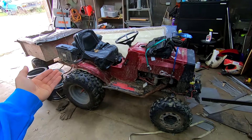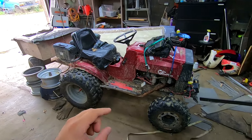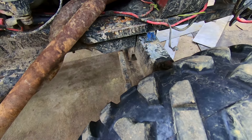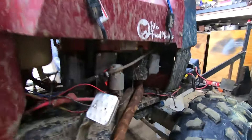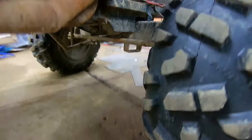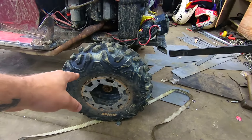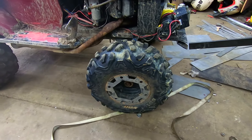So basically it's a pan frame Dynamark chassis that has been stretched two inches in the front with a two by three by three-sixteenths front axle for some extra weight. It's been all extended with, I think that's 12 gauge or 10 gauge steel. I believe that's five-eighths tie rods. We've got 19 by 7 by 8 Sun F's on the front — these are stock-like wheel horse front wheels with rock rings that I plasma cut out.